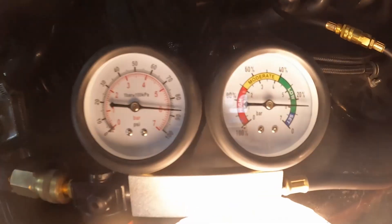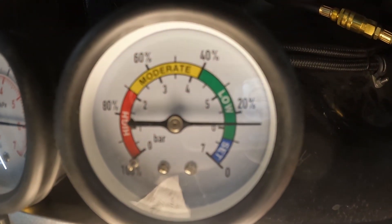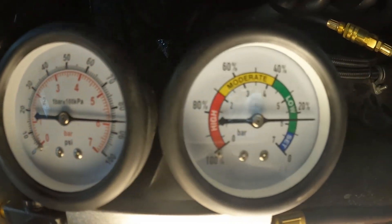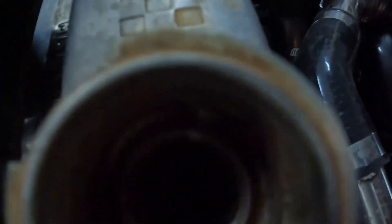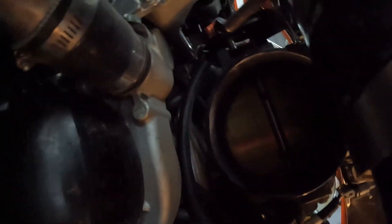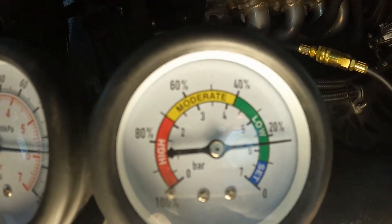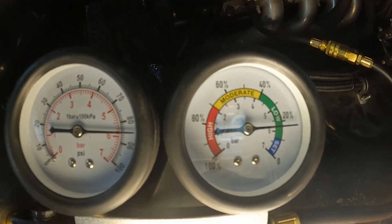Last step — hook up the hose to the car and take a look at your results. What you want to see is between five and fifteen percent. You can learn interesting things: listen at your radiator or intake manifold to identify where air is escaping. In this case the Camaro came out in good shape. I thought I had a cylinder head problem but I'm starting to doubt that — it may be something else.